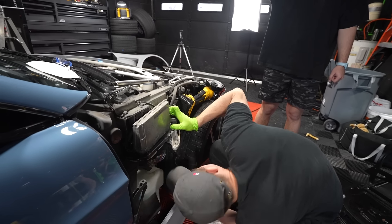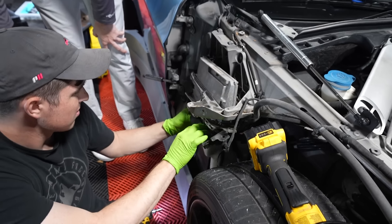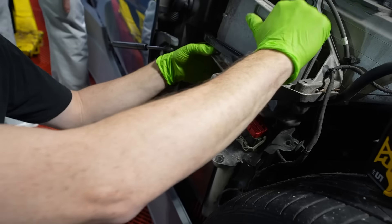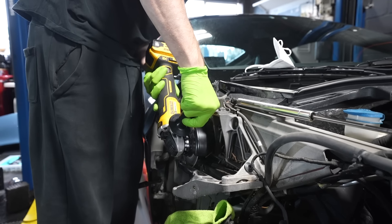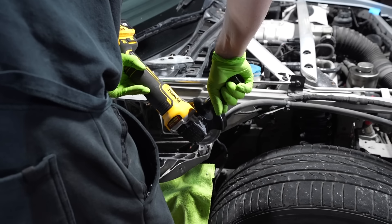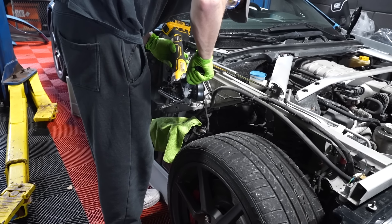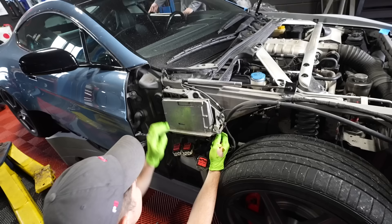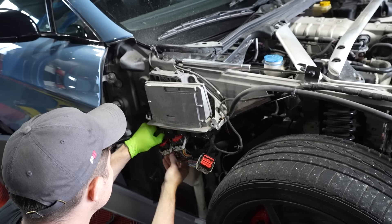Because basically all the wires in the car are routed straight to the ECU, it would be ideal if we didn't have to move it at all. With that done, we can unplug the ECU itself and unbolt everything holding it in place. Then with it out of the way, we can start to modify the bracket. With the bracket mostly removed, we can now try to reinstall the ECU, which luckily still bolts up. And now we can test if the fender fits properly, which I'm still not so sure about.